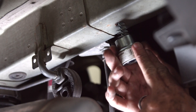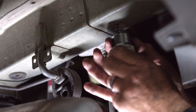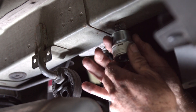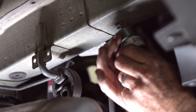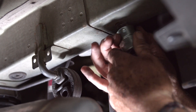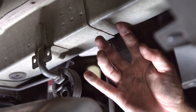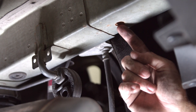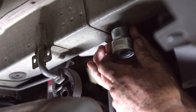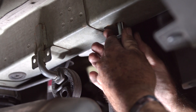We're at the passenger side frame here right above the exhaust. This is going to be our hitch attachment point on the passenger side. You can see that the weld nut has a lot of corrosion on it. Let's go ahead and clean out those threads — I'm going to be using a battery post cleaner. It's got some bristles on it, so we're just going to put it up inside. It looks like it's cleaning out pretty good; we'll continue doing that until we can see the threads nice and clean. I'm going to go ahead and put the provided bolt up in there and try to spin it on this weld nut.